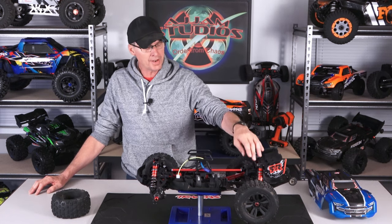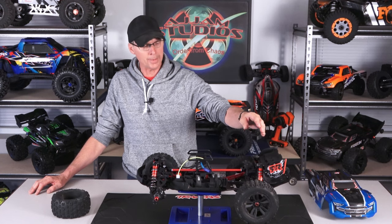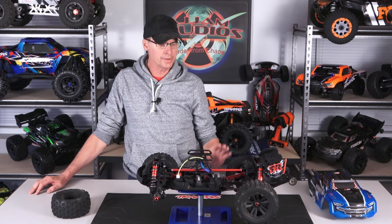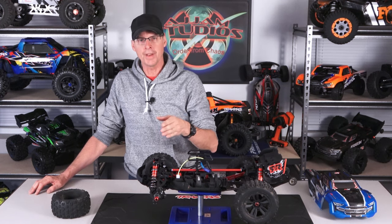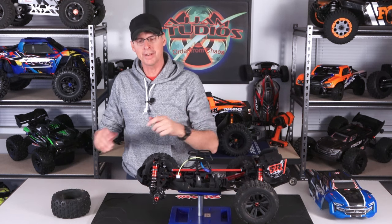I have pulled the fronts and the rears out and I've re-shimmed them just to make sure they're shimmed properly. But these are the standard diffs. These are not the EXB limited slip ones. I haven't had one of these fail yet. Just check your shimming, set your oil the way you want, put it back in,